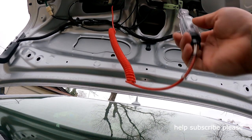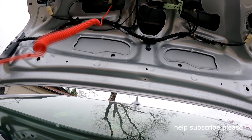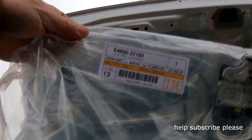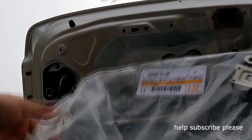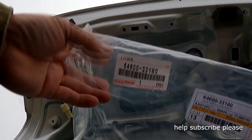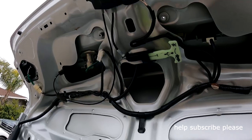These two pins are probably the return from the actuator, so that's why it doesn't work. The actuator is getting power but doesn't respond to the remote — so the actuator itself is bad. Here is the part number in case you want to order it online from Lexus. I went to the store and they said to order it, but the website didn't work great so they gave me an online price — came out to about $260.